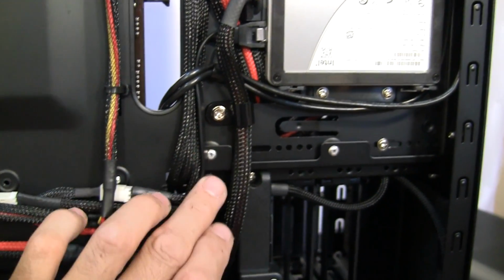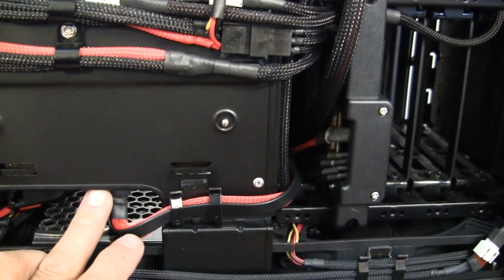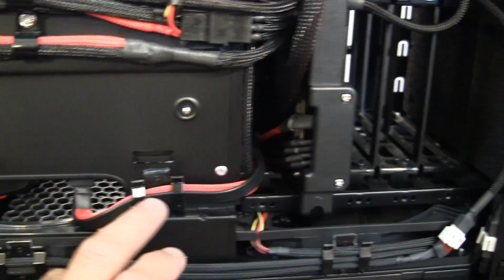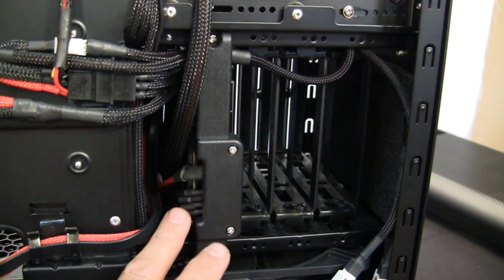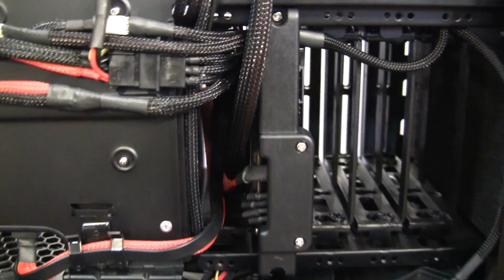And then for the data connector, it's pretty simple. It just comes all the way down here, comes back around, and then ties into the motherboard. Same thing with his storage drive. That's the red one here. Comes around, and that's located in the second bay here, where the hot swappable is, and it plugs right into there. Again, the same thing with the power connector.